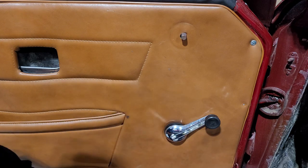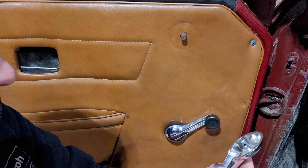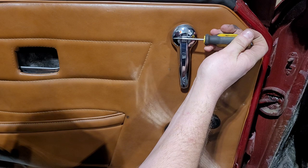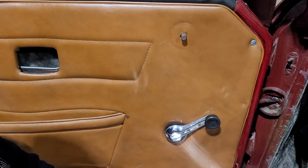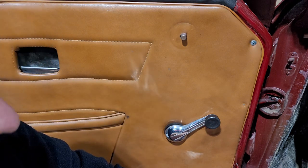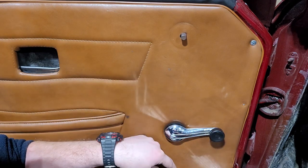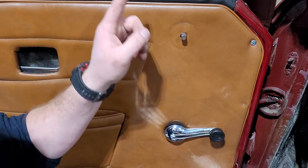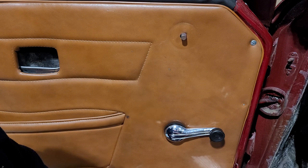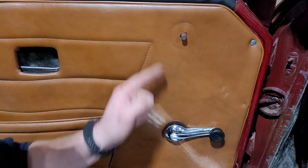To take it off, we want to find out which way the pin goes. Now if you're doing the door handle, it should be downwards — the pin runs across this direction. The pin basically looks like the end of a nail. For the window crank, some people will roll it up all the way and have it pointed down. That's a preference, it doesn't make a difference. But the pin can only go through the bar one way, so we have to figure out which way it is.